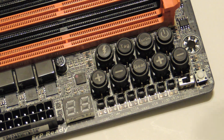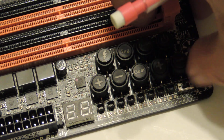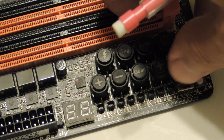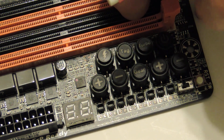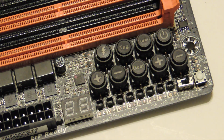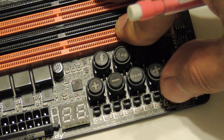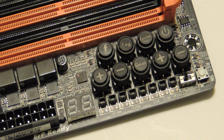So if I'm going from 8x to 60x, which is 6 gigahertz to 800 megahertz, so right now I'm at 6 gigahertz, press it, now I'm at 800 megahertz, so 0.8 gigahertz. But let's say I want to go back all the way, but I'd be at 6.1 gigahertz. Well, I can press 1 up, and then I'd re-engage the trigger, or disengage the trigger, and I'd be at 61. And then I can go back down, press up again, and then go back, and I'd be at 62. And go back, you'll always be at 800 megahertz.